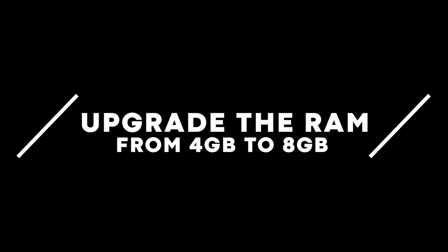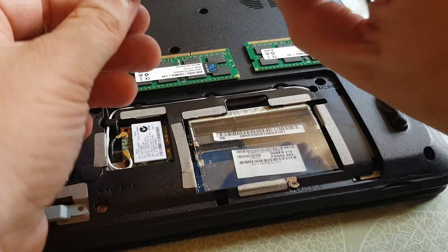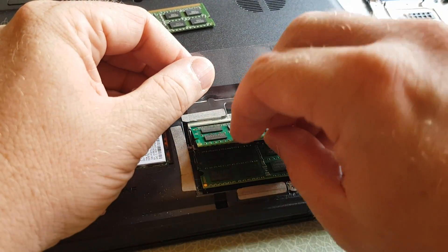The second step is to upgrade the RAM. Again, taking off that same plastic cover you'll find the RAM. This one had DDR3 RAM. Just look up DDR3 RAM for a laptop online — not for a desktop, they are different sizes. Check the frequency; this was 1066MHz. I was able to order 8GB online to fill up both slots. I could have just ordered a second 4GB stick since there was already 4GB in there, but I thought it best to get two the same just to make sure dual channel memory works perfectly. I popped out the old ones and put in two new 4GB sticks, giving me 8GB in total, and screwed the plastic cover back on.